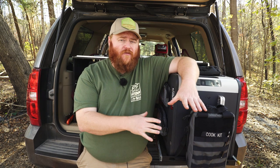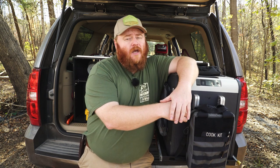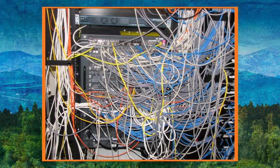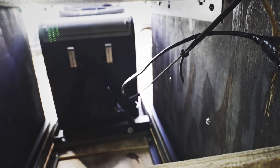Slides come in three popular styles: a straight slide where the fridge comes straight out; a tilting slide that slides and tilts out, useful if mounted on bed drawers; and a drop slide where the fridge comes out, stays level, and drops up and down. Some use straps to hold the fridge, others have a plate system that bolts to the bottom. Look for slides that lock both in and out, so you're not fighting gravity on a downhill slope.